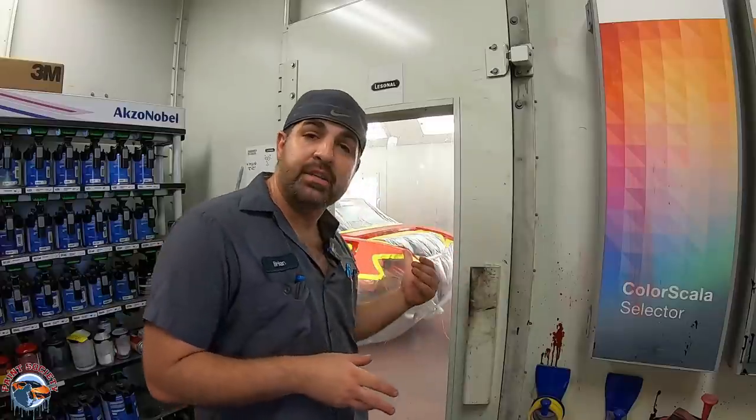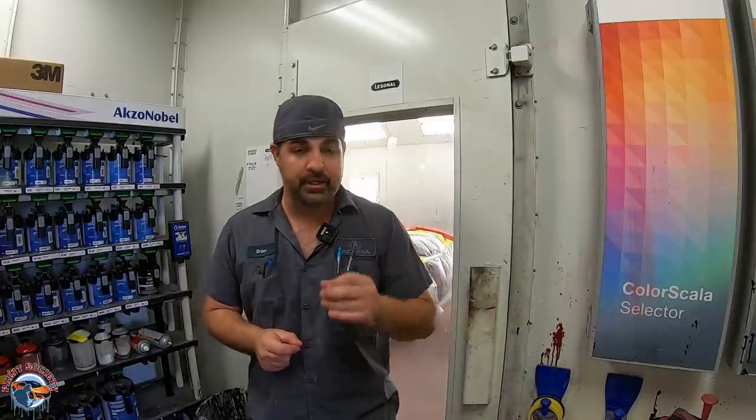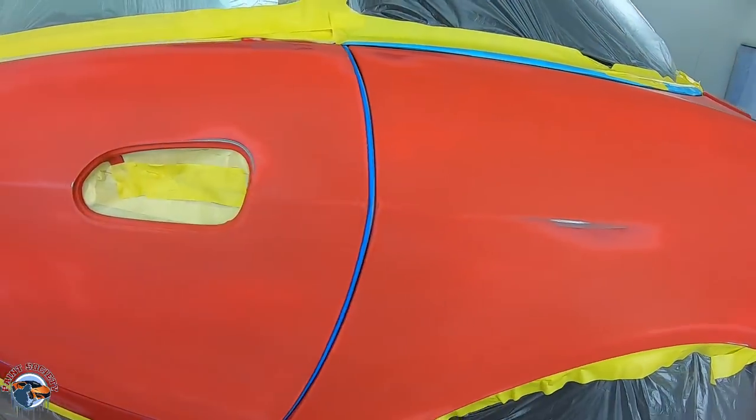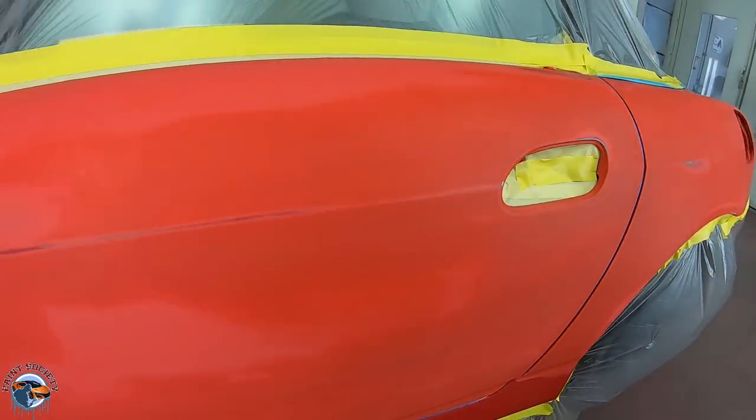So we have our S2000 right behind us. Now it's our job to put the right coating system on it to give us a superior finish. Now we're not gonna go ahead and jump the base just yet because we wanna use our sealer. Now what is a sealer? A sealer is a thinned out primer that does not get sanded. And it's gonna do two things for us. First off, it's gonna help with little different cut throughs or burn throughs to different layers of the paint when we were sanding. It's gonna bridge the gap and give us one uniform color.